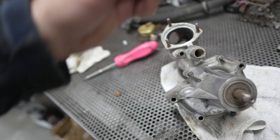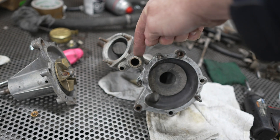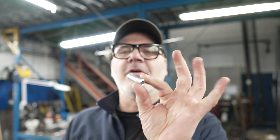The old water pump has two outlets, and I don't know how I missed those. After some research online I realized the older style water pump is actually really hard to get — next to impossible. So there is a modification for this newer style one. I've ordered two water outlets from Superformance, which I believe are the correct ones. I have the tap and drill for the smaller one, and for the 20mm by 1.5 fitting I've ordered a tap and appropriate drill off Amazon.